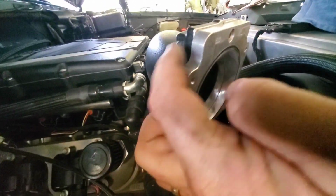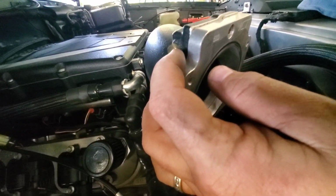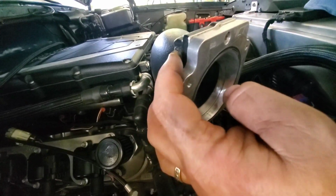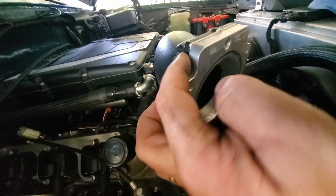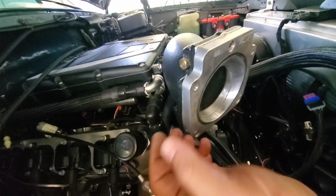And while that was off, that was the perfect time to go ahead and run a 1/8 inch tap down in there. I didn't have to drill it. It was already a little bit big for the tap, so it's not grabbing a ton on the threads, but there's no vacuum or pressure there or fluid, so it doesn't matter. It's simply plugging the hole to keep trash out. So, little thing there, tidied it up.